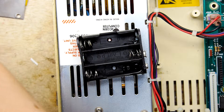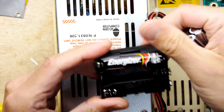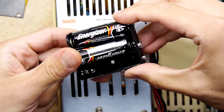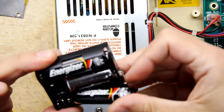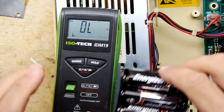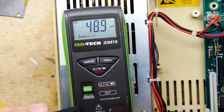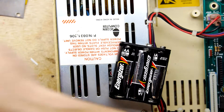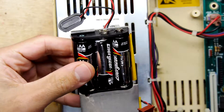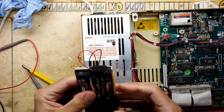Beyond that it should be reasonably simple — just a case of finding some batteries. I found three Energizer ones here. You want alkaline ideally — which most batteries are these days. We're looking at around four and a half volts. Let's check: 4.89V — that's pretty good, I'm happy with that. Then all you've got to do is pop that back on and push it right up to the edge so it's locked in.